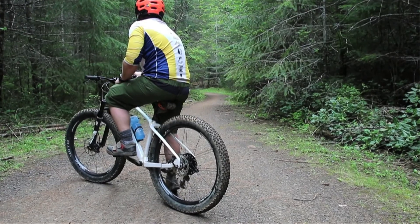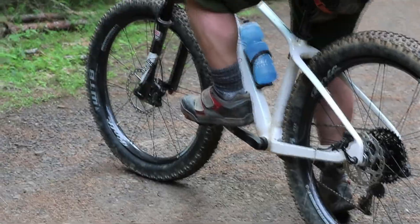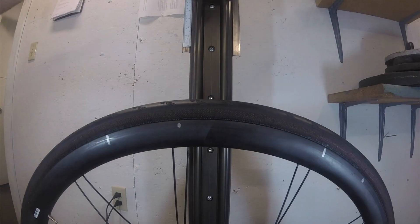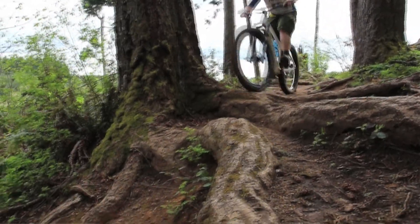With paired spokes, all the benefits that are true on road bikes are also true on mountain bikes. The nice thing is that we can set our spoke tensions a little bit higher than most people can by doing paired spokes. Which means when you make a big hit on your mountain bike and compress that rim a little bit, your spoke tension doesn't go down and your wheel doesn't start to come out of true.